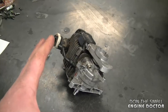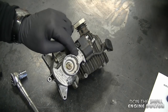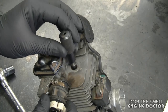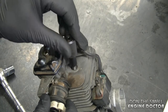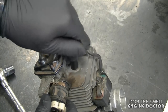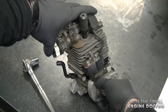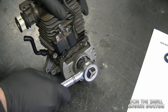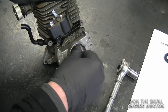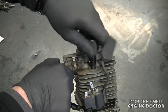I've already taken the block out of the blower. At this point, remove the 13-millimeter nut that holds the flywheel on. I've taken out the spark plug because I will not be using my impact to remove the nut — you can do damage that way. I'm going to put in this steel piston stop, which will lock the piston in place. With your ratchet and socket, just gently remove that nut. Then remove the piston stop.